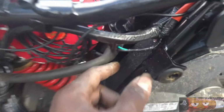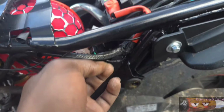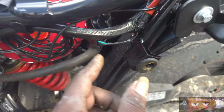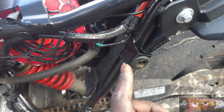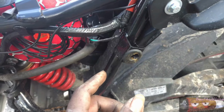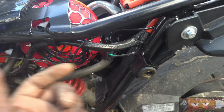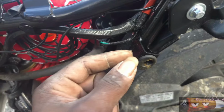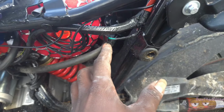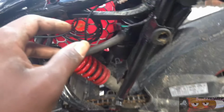Right now, you can hear it. Well, I can hear it. I don't know if you can hear it on camera. I can hear it hissing because of the 2 ports being open, the in and the out port over there. So yeah, I do kind of hear it hissing. But in order for me to actually run this catch can with this mushroom filter, I'm going to have to put plugs in it and face the plugs back and have the other out port, or the other in port, coming out this direction, so that way it's not interfering with the mushroom filter.